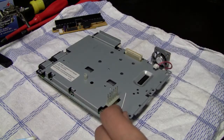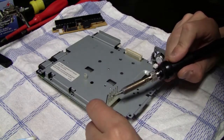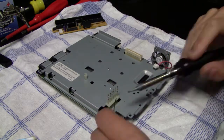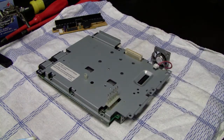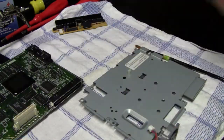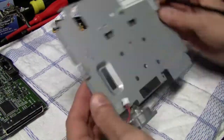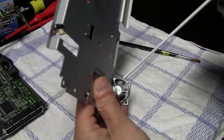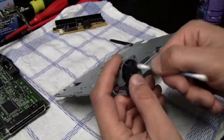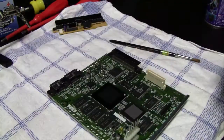This is just a precaution that I did, because it can happen that if your Dreamcast starts to restart during a game or anything, this can be one fix, because over time it can happen that the contacts between the motherboard and the power supply will become slightly loose, and then you have connecting problems, and then it can happen that during a game or anything your Dreamcast starts restarting the game over and over, or better, let's say restarting the controller over and over.